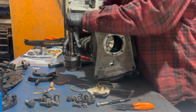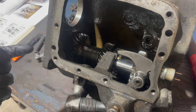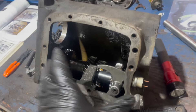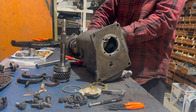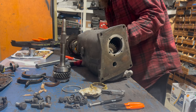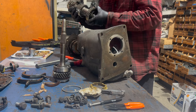To remove the input shaft and gear, you have to knock the countershaft through and drop the countershaft gears down but leave them in the case. Now that the input's out, I'll lift them up and take them out. Move the reverse out of the way. Take this assembly and bring it out, leaving rollers behind like confetti.